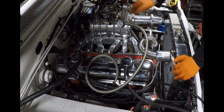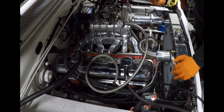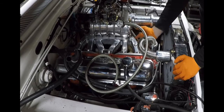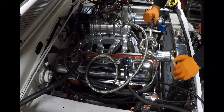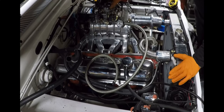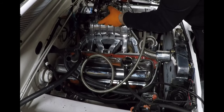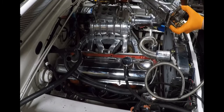I still need to pull this and do the inline filter, do gaskets between the carb and the heater plate and the supercharger. We're going to run this heater plate because it makes a huge difference in operability in cooler weather. You really can't rely on the exhaust manifolds heating the intake through the blower to the carb to a point where the carb's gonna run well. A heated carb is a happy carb. Here's the Lokar-specific low carb bracket right there for the throttle and kickdown cable.